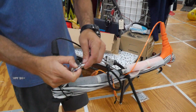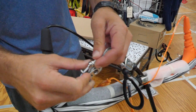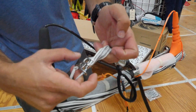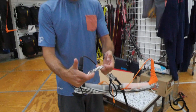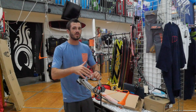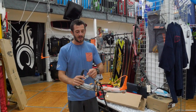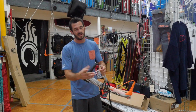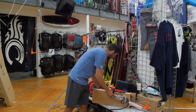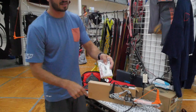So what they're recalling is this metal part. It's a pretty simple fix and we're going to go through that today. We're fixing it with a plastic piece. If you have a 2016 bar, you don't have to worry about anything — everything's all good because they used a plastic piece. This year they went to a metal piece, but they found that the metal piece rubs the line kind of the wrong way. So for safety reasons, they resorted back to the plastic piece.